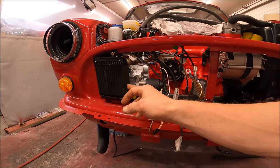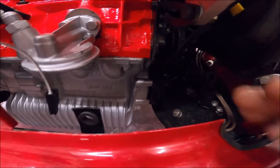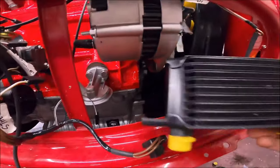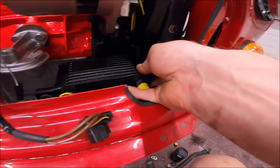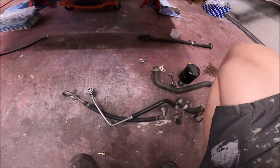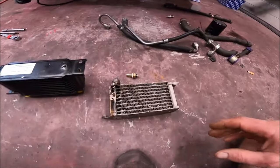The water cooler is in - I've just got some new fittings coming because they're a bit corroded. I was hunting high and low for the brackets for the oil cooler, which are there and there. The oil cooler actually sits in there like so. I'm just having a bit of trouble with the sender. I've got the oil cooler pipes all cleaned up so they'll go back in once I've managed to sort the sender. The issue I'm having - I'll just get the old one - had a sensor in there, and obviously it's a bit tatty so I've got a new one.